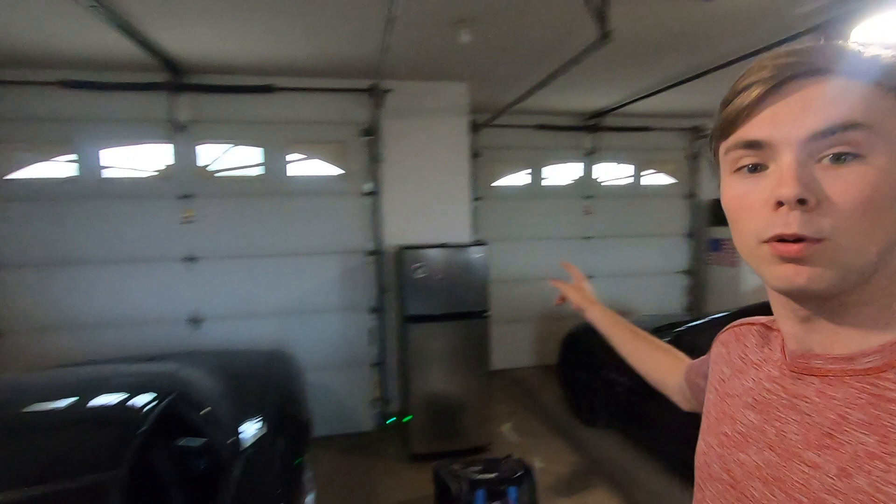Quick update. A week ago on Sunday, I pulled both my cars out — the Corvette and the Maserati. I've been driving the Maserati as the daily and driven the Corvette about three to four times. Then I took it to work on Tuesday to do tires and an oil change because it really needed one — the tires were so bald, showing cords, they had to be replaced. During the oil change I grabbed a sample of the oil because it looked a little shiny and when I put my flashlight in it, it was quite metallic.